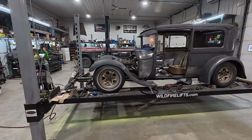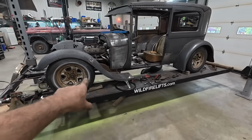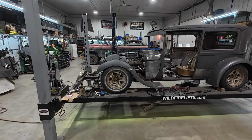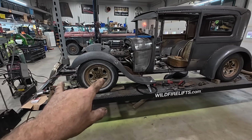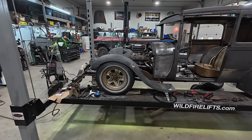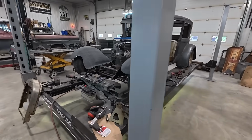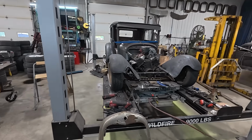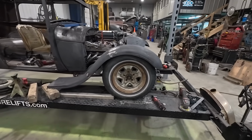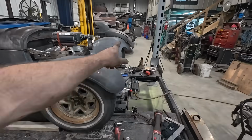I feel like this one I've got to move a bit, but it might have moved on me. I'm going to have to measure again. I was clamping, just making sure that my wheelbase was staying the same. I'm not too concerned because we have adjustment in the links that we can pull everything. I just want to get them pretty close. If I can get them, even by eyeball, within a quarter inch, I have lots of adjustability in the link down there. So this side feels like it's not as far forward as the other side, but we can fix that easily. It just needs a little adjustment and a shove. Yeah, because this one's definitely a better fit. I think my fender, everything's good on this side. I think that fender needed a tweak though.